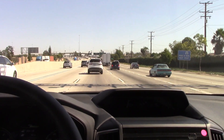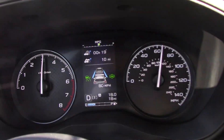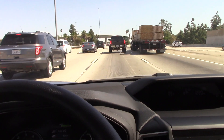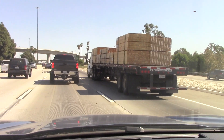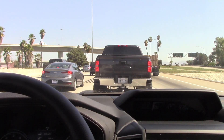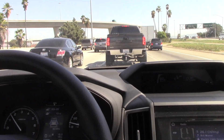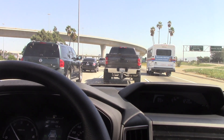Another thing to think about with the cameras is what am I following? Right now it's not locked on to anything. Now it is locked on to this truck in front of me. I'm accelerating and now I'm going to brake — and I'm not doing that, the car did that. So I'm following a big giant pickup truck here and the car is going to have no problem figuring that out. But think about a flatbed delivery truck — if it had nothing on it, what is the car locked on to? Is it locked on to the back of the truck or the back of the cab? So just kind of watch your following distance. Now we're just barely rolling forward — this is where the adaptive cruise control does its best work because I haven't come to a complete stop, I'm just barely rolling forward and the car is just taking care of it.